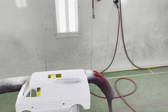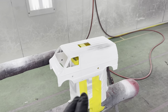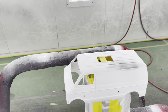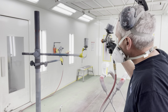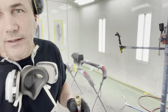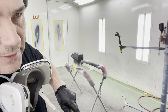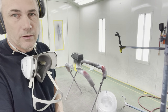All right guys, like I said this video is going to be a little bit all over the place. We're going to get our first coat of paint on the Lunchbox. We filled up the antenna hole and put a little bit of glaze in it — a spot primer will be all right. We're going to seal this in black, put a black base on it, and then we are going to flake it out with silver flakes. We've got the black on, now we're going to put a coarse metallic silver down, and then go back and put the metal flake over top of that with clear.